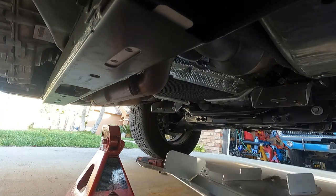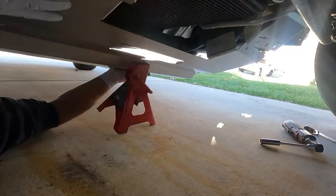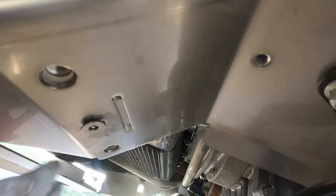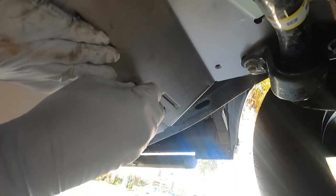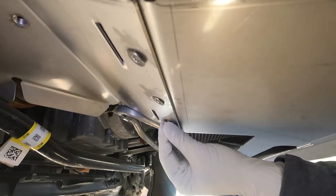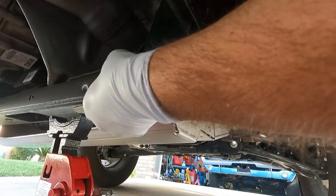Now here's the tricky part. I'm going to try to slide the main shield in here and rest it up on the jack stand. Now I need to get the parts of the main shield underneath. I'll get the middle one started for now — I already put thread locker on all of these before bringing them down. Just getting the middle one started on the passenger side, then we go do the driver's side. Thread lock makes these slippery and kind of hard to get started, but you can do it. Get these two started on either side, then start those on the passenger side. I put the top part back into the jack stand to bring it up a little bit taller.